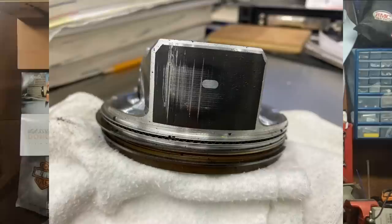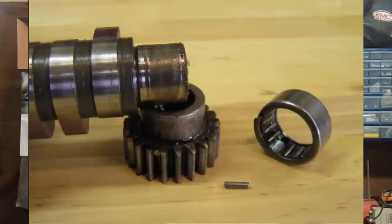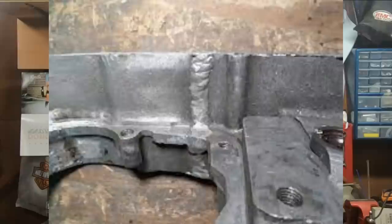As for the quirks of the Evo engine, they're not nearly as serious, and they're definitely not as expensive to fix as they are with the Twin Cams and Milwaukee 8s. On any Evo you might encounter some base gasket leaks — that's pretty much almost a given. And in the 90s they went to that crappy INA cam bearing, which was a disaster, but it's all easy stuff to change out. In the 80s there were some casting issues with the cases — if you put too much horsepower in them they tend to crack — but if you're not modifying an 80s model it's not an issue. Parts are very, very inexpensive compared to the Twin Cam or Milwaukee 8.